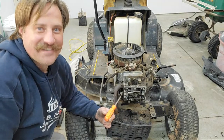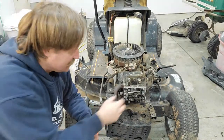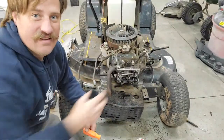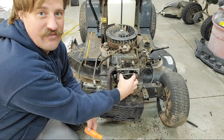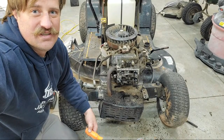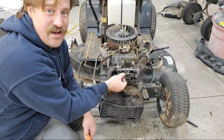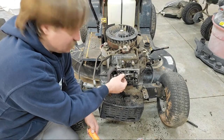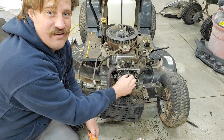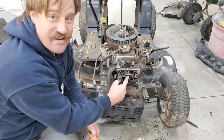Okay, now what? Now check the slack on the rocker, she says. I don't feel any slack on the rocker right there. Too much slop in the valve rockers. Wait a minute. Too loose? So that right there, is that the slop? I don't have the feeler gauge. So does this thing need to be tightened right here? I do have spark. So tighten that right there.